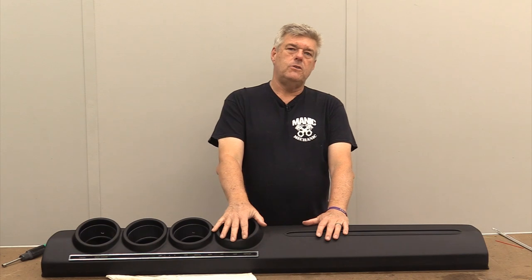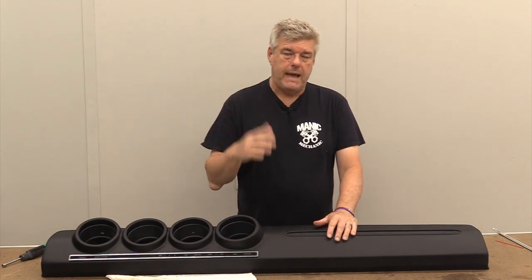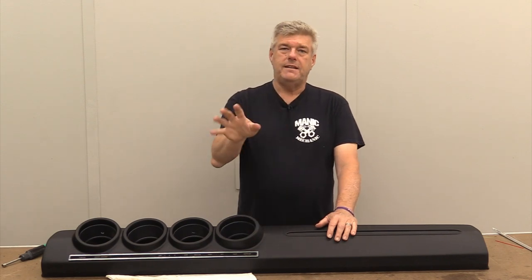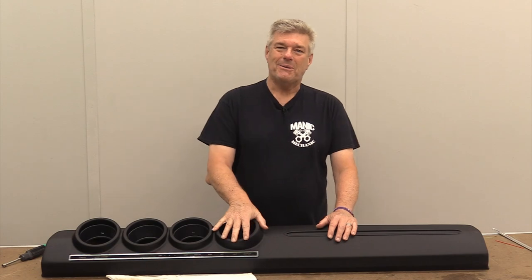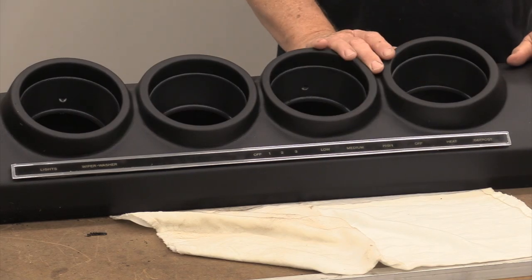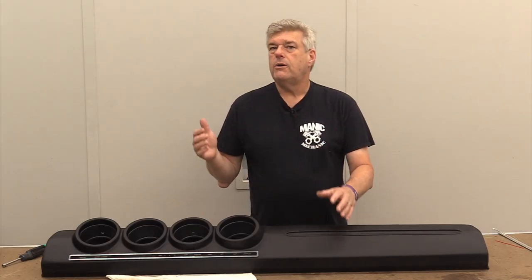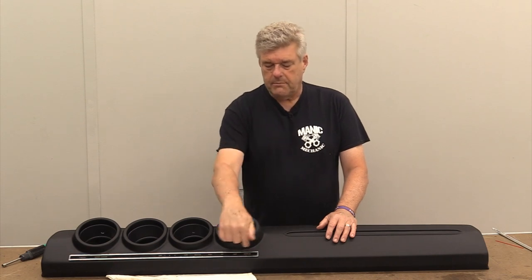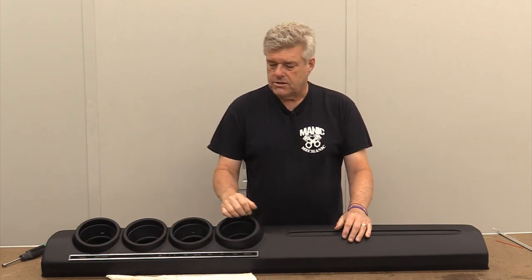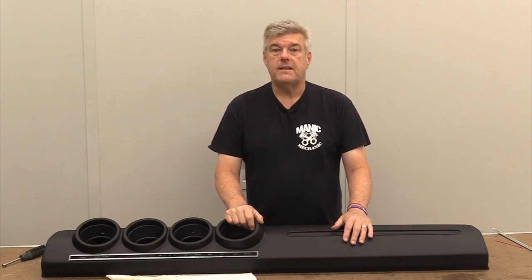In the case of don't do as I do — do not do what I did on this dash pad, which is try to cut it from the back. I screwed up the dash pad, I really did. That's how bad it is, that's how embarrassed I am by what I did. It looks trashy if you cut it from the back. What you'll want to do for this panel is to go in and open it up from the front — make your cuts on the front side down on the bottom of where it coves into the dash.